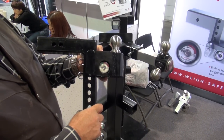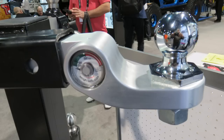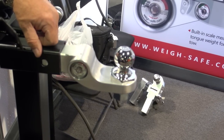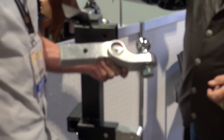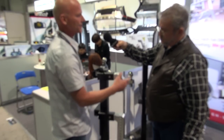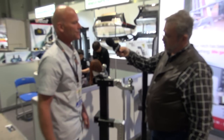And then this is the original, just a straight bar — the original hitch they came out with — and they're reintroducing it this year. It's a no-ball system: you just buy this draw bar, put your current ball on it, and it will measure the tongue weight with your current ball. You can make it economical enough for anybody to buy. The guy that just needs a draw bar can buy a seven-dollar ball, put it on this, and measure his tongue weight.